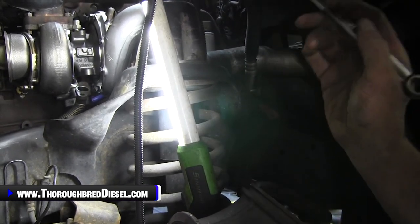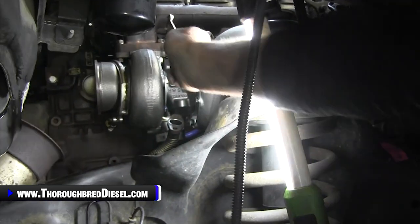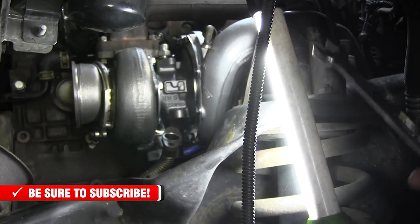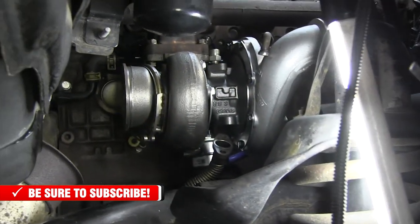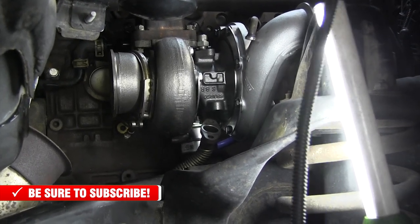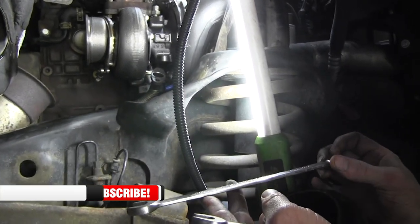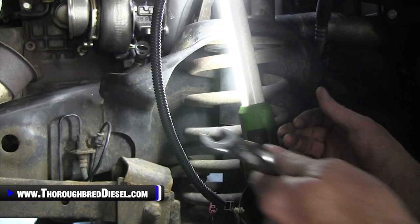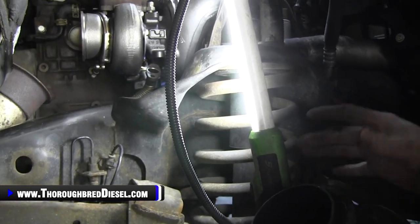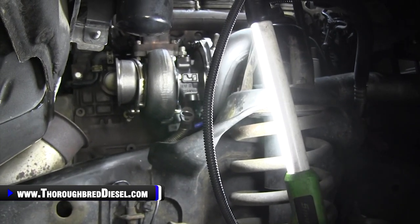The nut on the inside on the inboard stud, the one closest to the motor, is probably the worst one. I'm going to tell you, use a longer 15 metric and just get it lined along the block there, then make a couple of small turns, and eventually you'll get it. It's not that big of a deal. It's just something you've got to work at. So open ends, get everything tight, and make sure everything seals there.